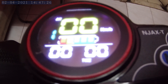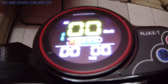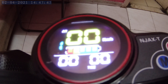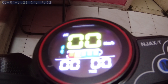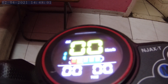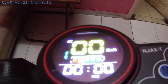This video will help guide you through the P settings of your scooter from P0 to P5. The first setting is P0, which is for specifying the wheel diameter of your scooter. This P setting is very important because you need to specify the correct diameter, as it would affect the values shown on the LCD screen.